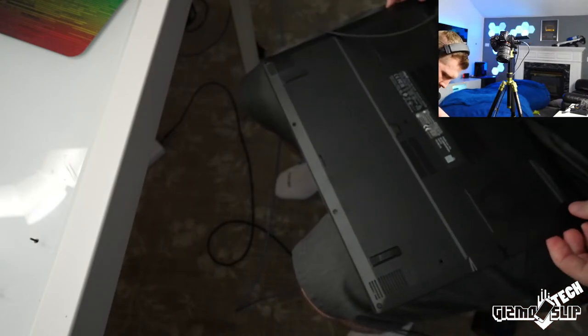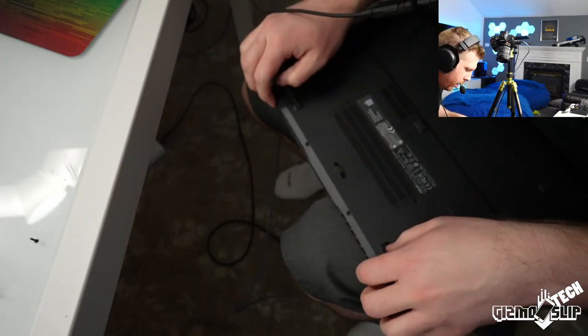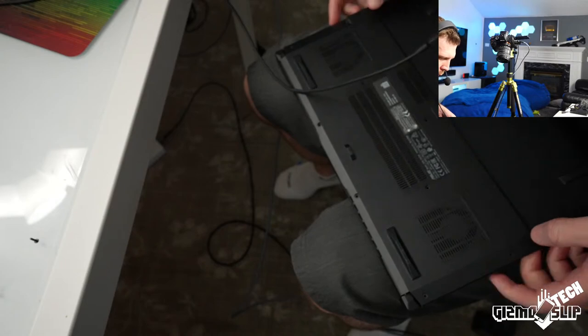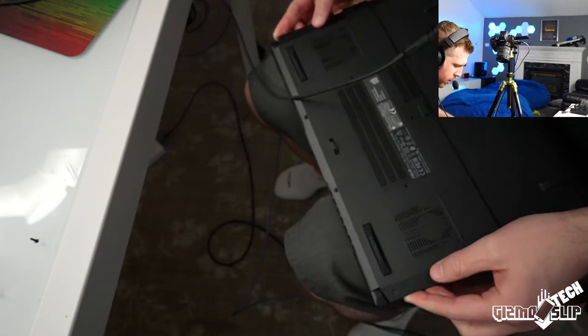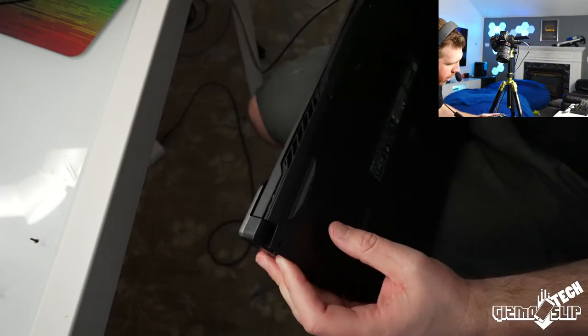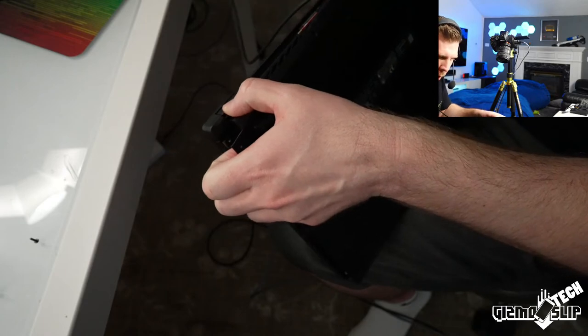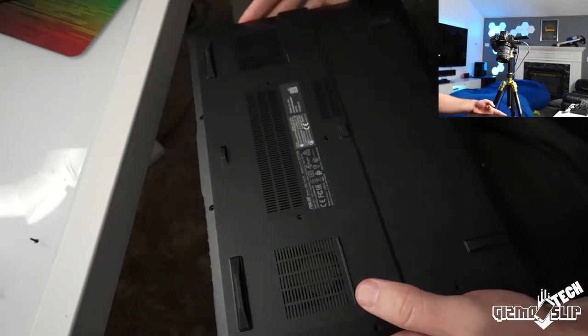I don't think this has any LED wires to worry about, but if you've got a laptop with like a LED ribbon in front, oftentimes that will have an electronic connection that connects to the bottom of the chassis, like on the Strix series. So you want to be extra careful with some laptop chassis when you're taking them apart. Cool. So I can put this back now.